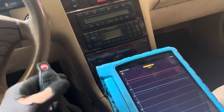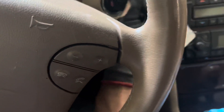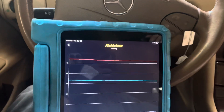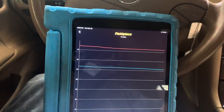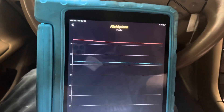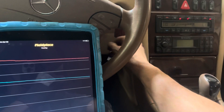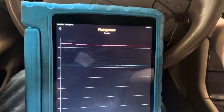Alright, let's try that again. This time I have a jumper battery on there and we tried to graph this compressor — that's real life. This time the alarm actually went off, I heard some solenoids in the doors, so we now have power to start the vehicle. Low side pressure, high side pressure — the vehicle has just been charged, never been started. This vehicle has been sitting here for about a month. Here we go — we're still low, high fan speed, recycle. I want to go for the coldest and fastest I can get it.